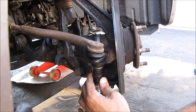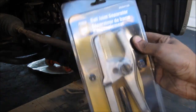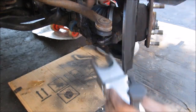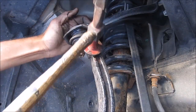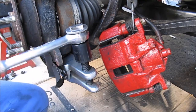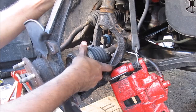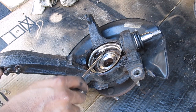Next I'm going to remove the 17mm tie rod nut. You're going to need a ball joint separator to separate the taper of the tie rod and the ball joints from the steering knuckle. I'm just going to put the separator in — and my tie rod just popped out. I've got my ball joint separator on there. After everything's been disengaged from the steering knuckle, we're going to pull out the CV shaft and remove the knuckle from the vehicle. Here I've got the steering knuckle removed from the car.